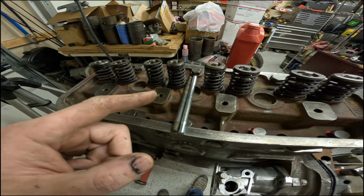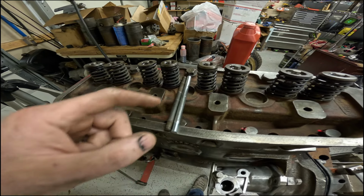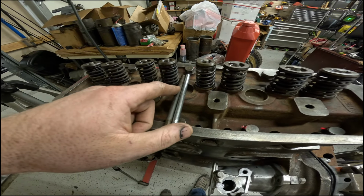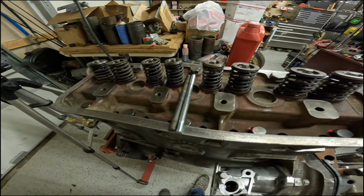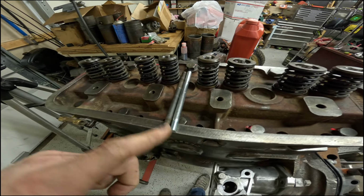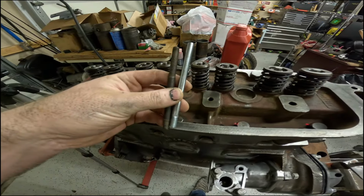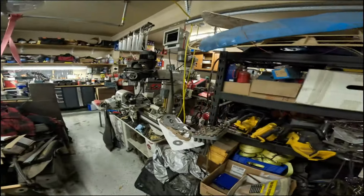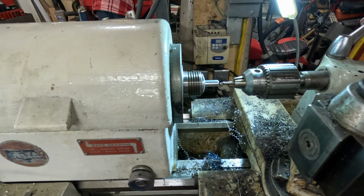We're going to use our lathe. We're going to go through and get this set up so that we're in a good place for it. We have to pop a fine thread on the end of the fastener, which is going to be a bit of a challenge. So we're probably going to make it a little bit differently than they did. And then we need to square up and chamfer both the ends. So we're going to get cracking on that while Jack is very busy sandblasting all the parts. All right, this will be better. There we go.